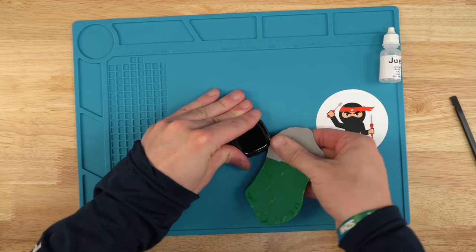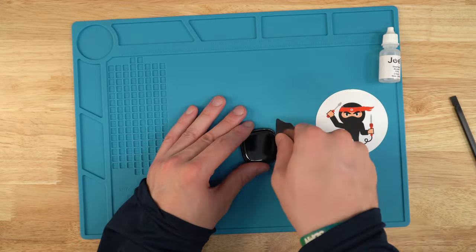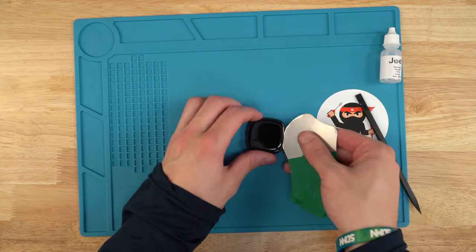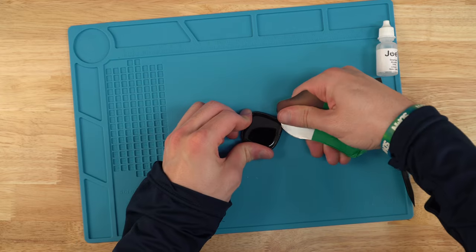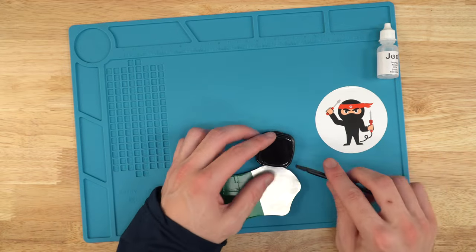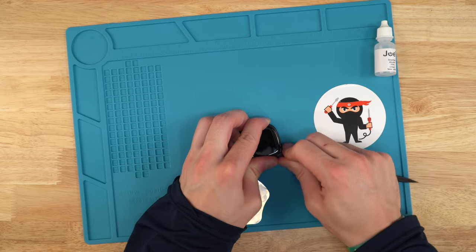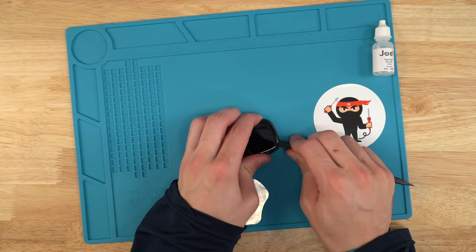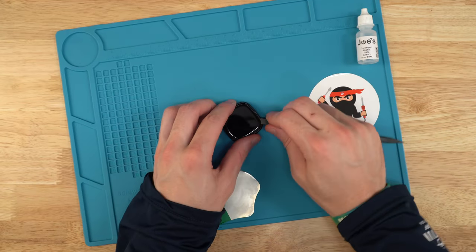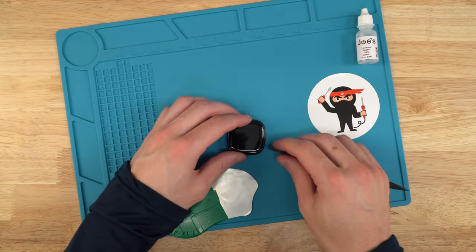Work yourself into a corner — working from the corner is the easiest. You don't want to go too deep because you don't want to poke the LCD if yours is good and you're just trying to open up the watch. Once you're in, get your spudger in there — that's how you're really going to get it off. It's not very deep, literally just that much. Once in, run it along the very edge and pry up.